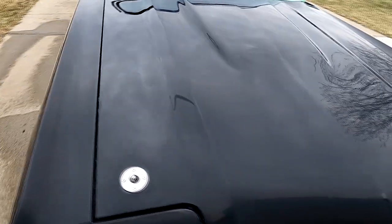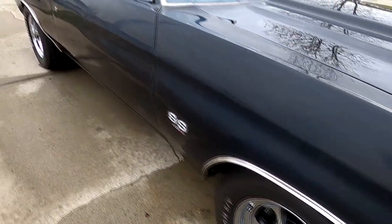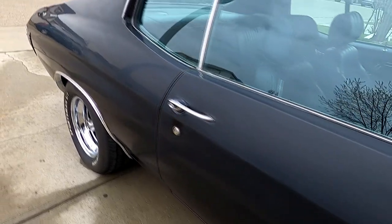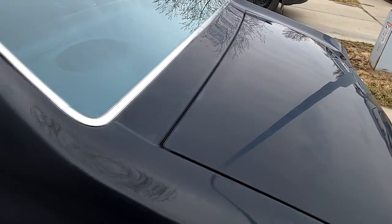After doing another complete washing of the car, there was visibly a huge improvement over the wet sanding that was done by hand using 2000 grit sandpaper. The finish wasn't as good as it looked inside the garage, so I'm hoping it's sufficient for the compound to cut to an acceptable finish.